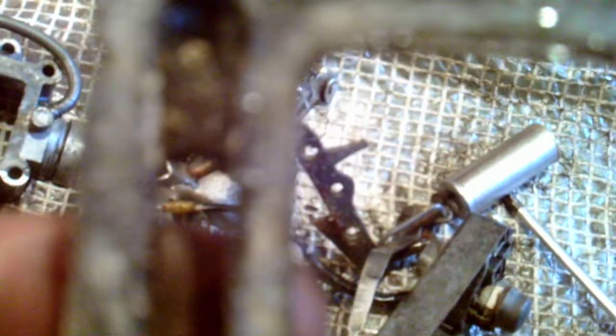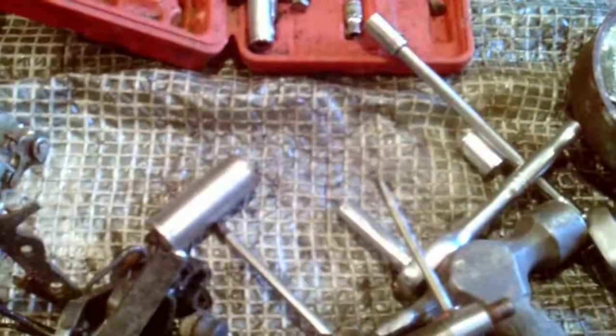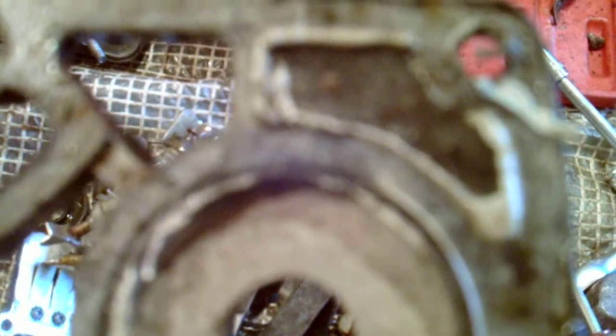But that hole there is where the oil seal goes. The waterways are there. Ooh, there's one. You see the holes? They've got to be cleaned out. Another one there. Where my finger is, that's got to be cleaned. And so on. Those big holes, I think, are bolt holes. One there, where my thumb is. One there. One there. The others, I'm not sure about. I'll work that one out and tell you. But you can see that funny line stuff is instant gasket. So someone's had this apart before.